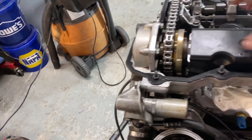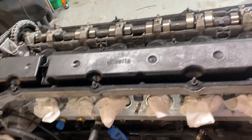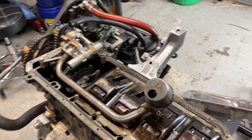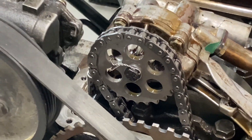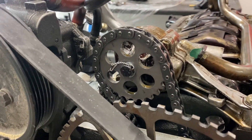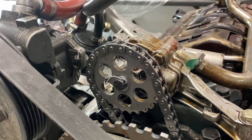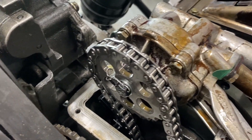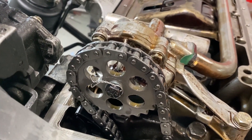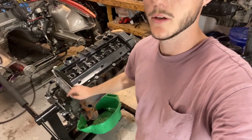Spark plug tube gaskets are on, this gasket's on, everything's been gasketed. All that's left is our intake cam cap — it clears everything there. Cam capped. Before we flip it back over, I just wanted to show you — if you haven't done this, please do this. It's so important for M52s. That's an Achilles oil pump shaft that I pressed into this pump, and then I have the safety wire and the reverse locking nut so this one's not going anywhere. You can weld them or do something like this — upgraded pump with an upgraded shaft.